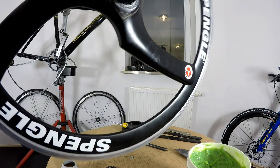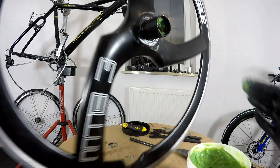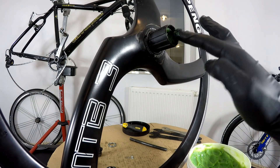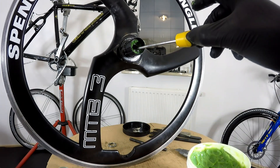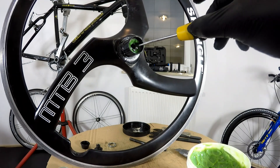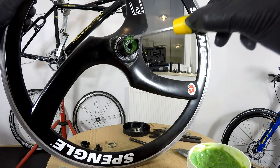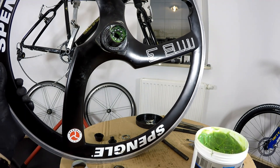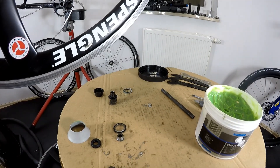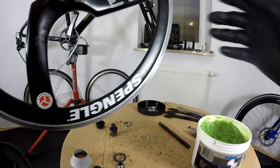Now we're going to put some grease in here and then all nine balls. I have my magnetic screwdriver which is very helpful. This is the angular bearing, and Shimano says that this one works much better while cornering. When you do the overhaul like this, I didn't know what I was going to find on this hub — you always want to make sure that each part comes back in the same order, so I just put everything on the table so I know exactly how it goes back in.